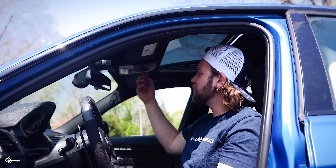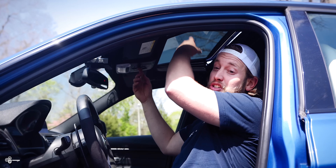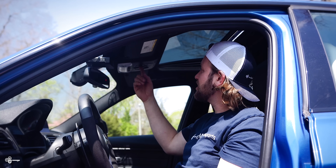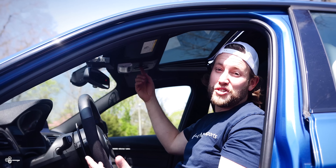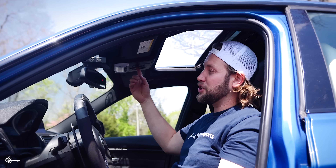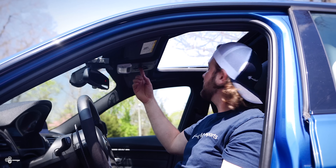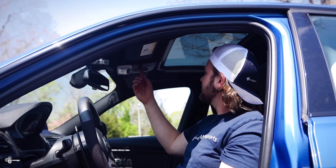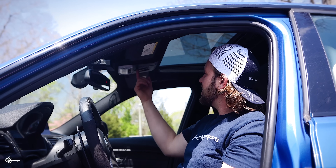Don't let go — you're going to want to hold it for roughly 20 seconds or so. What's going to happen is this is going to close, and then it's going to fully open and fully close again, and then everything is successfully reset. Just keep holding it. Again, make sure that the car is on or this will not work. As you can see, I'm still just pressing and holding the vent button. It's opening, it's closing. Now let's test it out — everything works great.